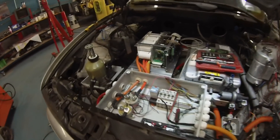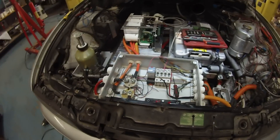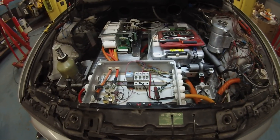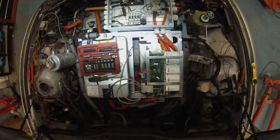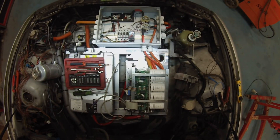So we really do need a pre-charging system, and that is what we are going to fit now. It's incredibly simple, but it's a concept that I don't think has been explained too well. How do we stop the EV version of the china syndrome? All we need is a resistor and a relay.